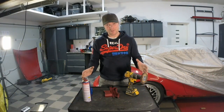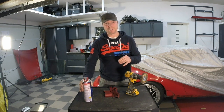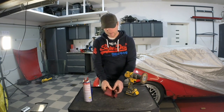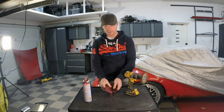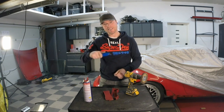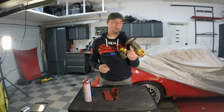This is what I'm going to use to try to get the windows out — a little bit of WD-40 just to lubricate a little bit between the seal and the window to try to break the friction there. Some plastic wedges and crowbars to try to pry the window out from the seal. If that doesn't work, I've got a carpet knife to cut the seal and just lift it out. After that, I'm going to inspect the surface a little bit because there are some rust-prone areas there, and I want to get a feeling for how bad it is.